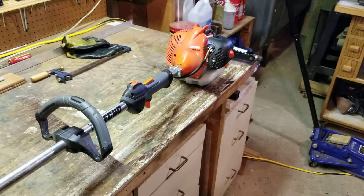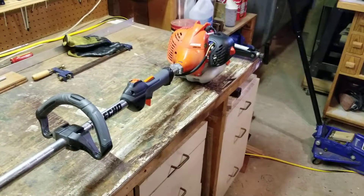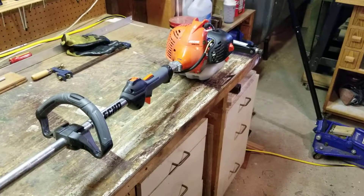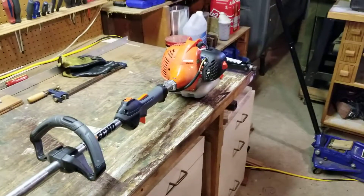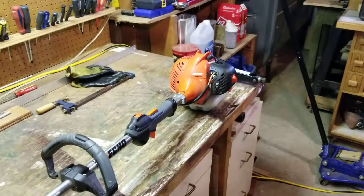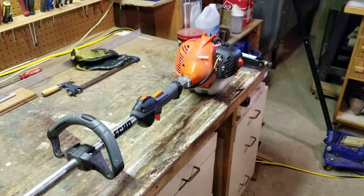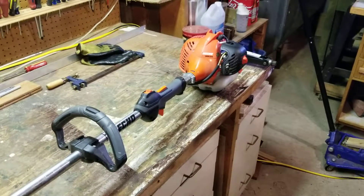There's really not much that can go wrong with a two-stroke engine. This is a simple little two-stroke engine. By the way, I did look at the Hondas this morning — they were a lot more money but they were four-stroke engines made in Thailand. It's nice to have a two-stroke — they're so simple. If you make sure your fuel is proper, this is a 50 to 1 oil mix, and you either put fuel stabilizer in it in the fall or do like I do and just run the things dry — there's really not much that's going to go wrong. I'm not sure those critical reviews had any of that done right. Anyway, good little machine, very comfortable, glad I bought it. I think it's going to last me well, as long as I need one.